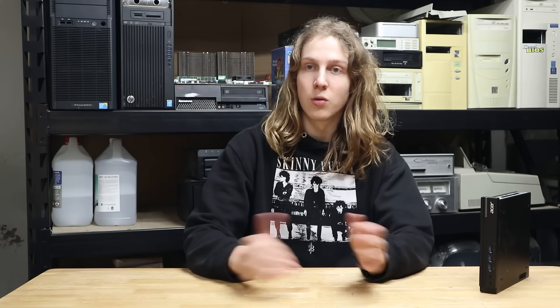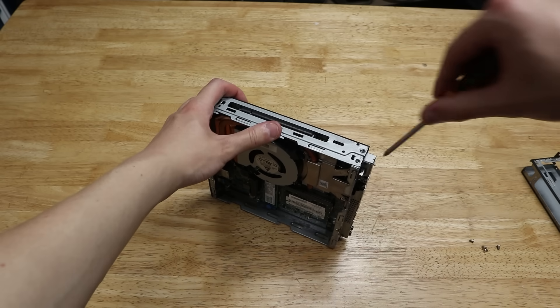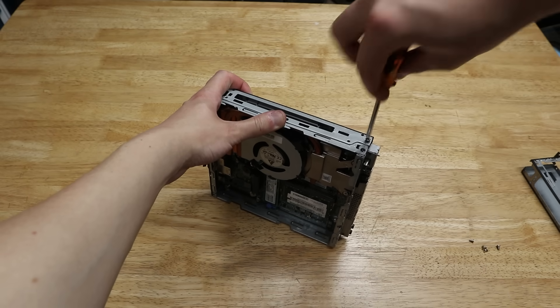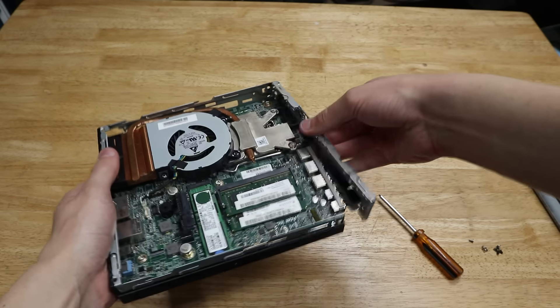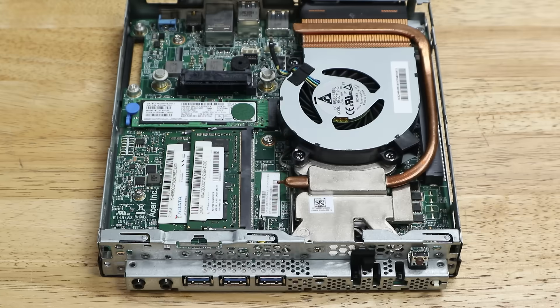In terms of ease of disassembly compared to other mini PCs, this one isn't amazing. To remove the motherboard, you start by removing the graphics card, then the metal case extension that houses it, then the front piece of the case covering the IO, then the fan, then the heatsink, and finally the board can be unscrewed and removed. It doesn't lift upwards nicely — it has to be lifted slightly and slid forwards out of the case to avoid damaging the board. On the positive side, the M.2 SSD slot features a tool-less clip instead of a screw and standoff, and has two locations, also supporting shorter 2242 SSDs.